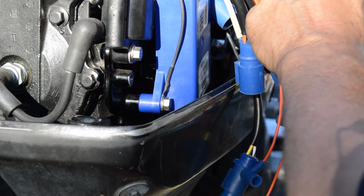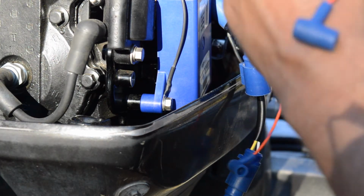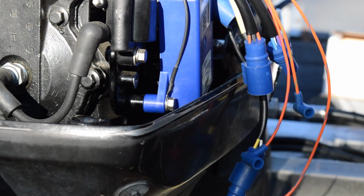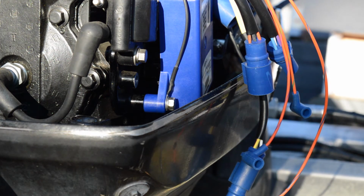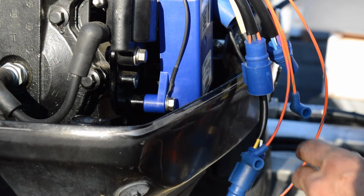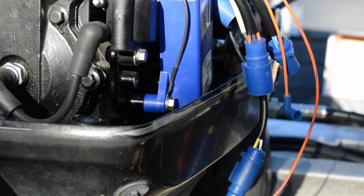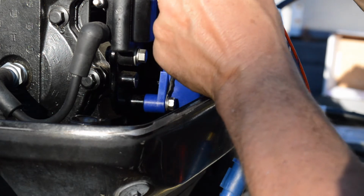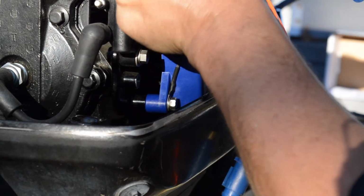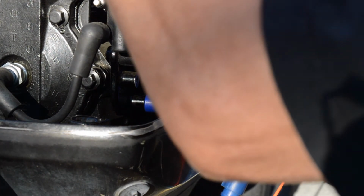Now I just got to look at a wiring diagram and figure out which one of these goes to which one of these coils. Which I got a wiring diagram somewhere. Hopefully it's right. Of course this one doesn't say 1, 2, 3. So orange, purple. So they're saying is our number 1. So I'm just kind of looking at my wiring routing here, see if I can't route it some way that halfway makes sense. Goes like, maybe like that.